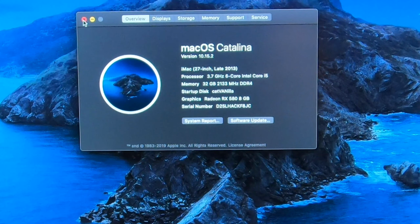If you'll remember, when we started this, I had Clover Configurator on the desktop. So now what we have to do is copy that EFI folder from the EFI partition on our USB to the EFI partition on our Mac hard drive. So we're going to use Clover to do that. Open it up. Now, when you get that message, you have to right-click and go Open, and then Open. All right, and I hate this tips thing that comes up now with the new Clover. We're going to mount our EFI. This is our USB, so we'll go ahead and mount it first. Put in your password.